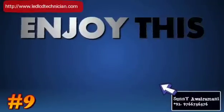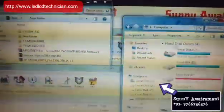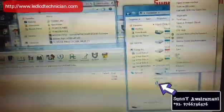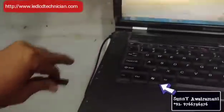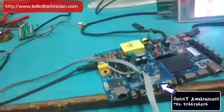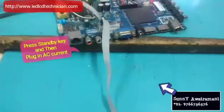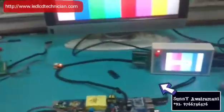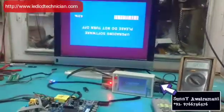Let's go to the table and we will use this pen drive. I inserted the pen drive into the USB slot and plugged in the AC, but the software didn't start. The reason is that I didn't press the standby button first. You need to press the standby button, then plug in the AC supply — that is how you start the software upgrade.